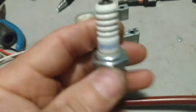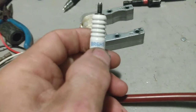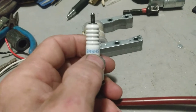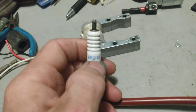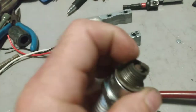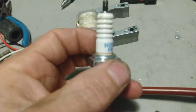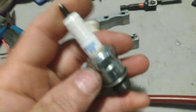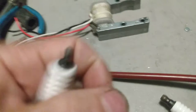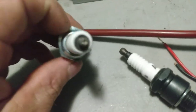This is a better plug. When you're looking at plugs, you'll see your number — the number is your heat setting. Six heat setting. The lower you go, the hotter the plug. So if you pull your plug out and you see that your plug's burning too hot, you want to go up a number — so I would go up to seven. If it's not, you go down to a five. I had to take a Dremel and cut the fins out around where the spark plug goes because of the size of this plug versus the other one.